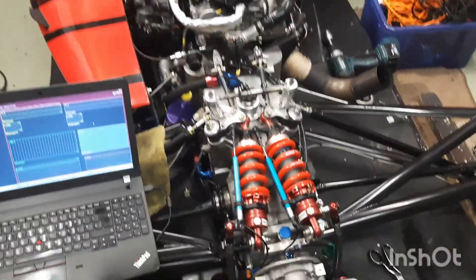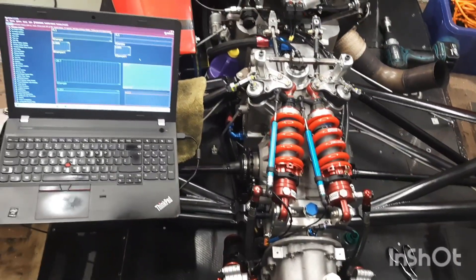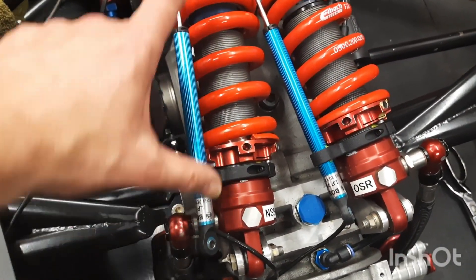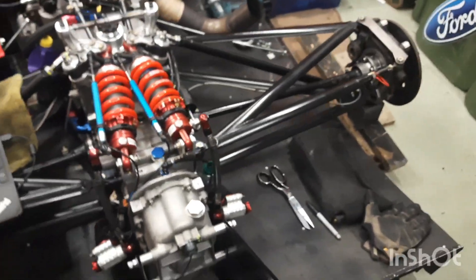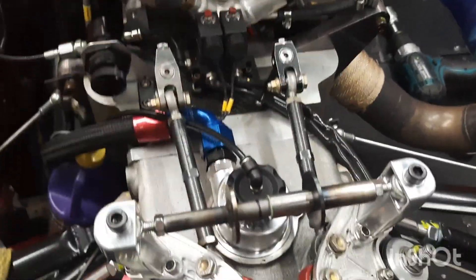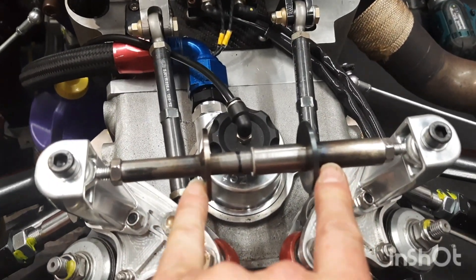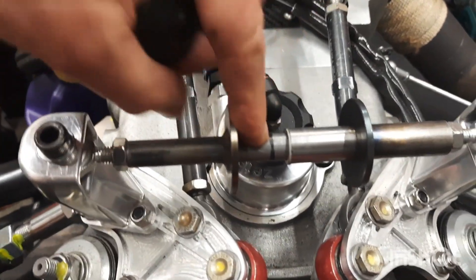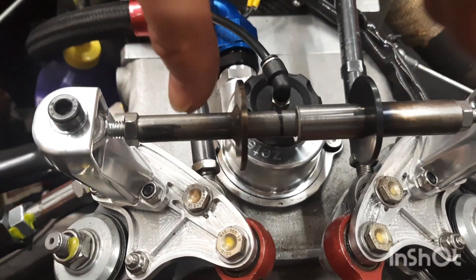I'm out in the garage doing a little bit of development work. What I've done is loosened off the bases of the springs and wound them right down to the bottom. This has allowed me to lower the car, which is currently sitting on wooden blocks, down until it's actually sitting on the bump stop rubbers, which have packing spaces in them, so they're fully compressed. What I'm trying to work out is the safe gap that I have to run the telescopic piece at to avoid the telescoping arm from binding — if these two pieces get anywhere near that black line, it will bind and do some damage.